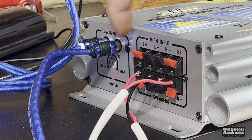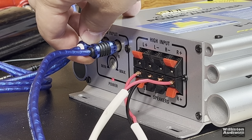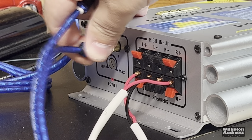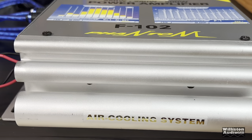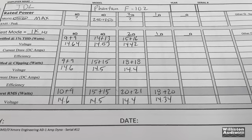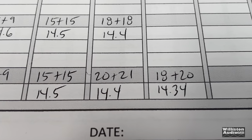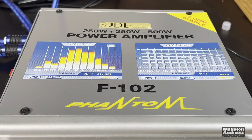You can see the power LED down here. I'm going to disconnect the ground connection from the amp and I think what is happening — see how it still stays on — I think it is getting the ground from the RCAs from the head unit. Let's pull off the RCAs and see. There you go — no more light. So the amp shut off. The air cooling system of the JDL F-102 Phantom definitely helped out. This so-called 500-watt amp only made about 40 watts. Head units will do more power than this flea market amp.